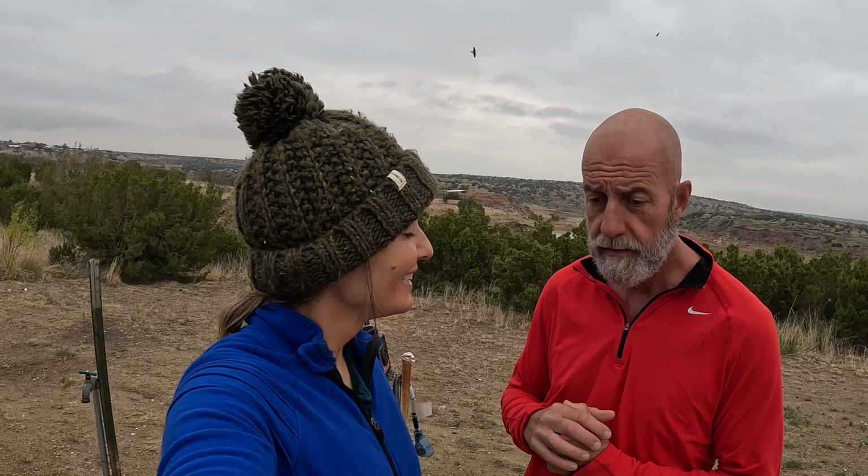But as we were heading towards Arkansas to visit family, we're going to go camp together. And my cousin Billy told me that the place we're going, the sites are big enough and they allow you to double up 2 campers in the same spot if we can't get our own camp spot. He said what they do is they get an adapter, and one person plugs their 30 amp into the 30 amp, and the other person puts the 30 amp adapter on and plugs into the 50 amp, and it works great. I'm like, didn't know that existed. So I bought one just in case that ever happened.